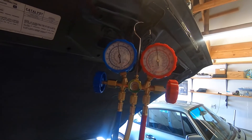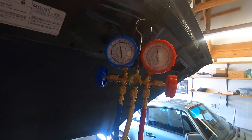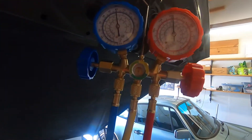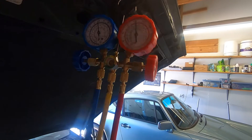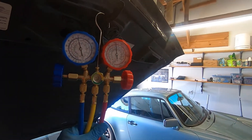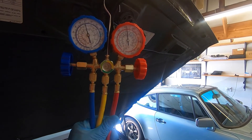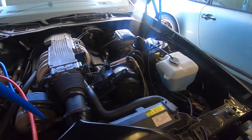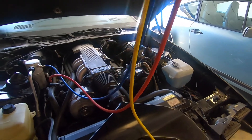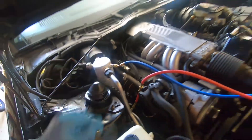Don't be confused by the numbers on the outside ring — the R12 ring is actually on the further side at a lower amount, which scared me at first. We're pretty much empty; the can is empty as well. The compressor is fully locked. Keep watching the gauge — it's cooling. This is actually nice and cold. I can feel it. That's awesome.